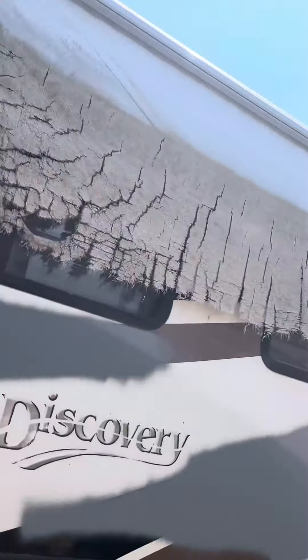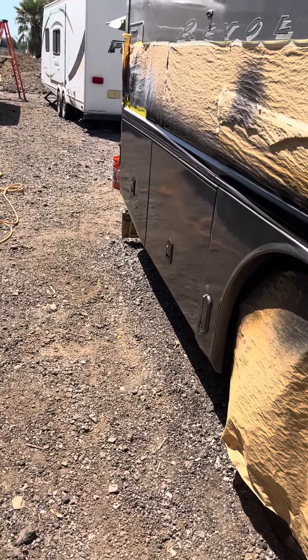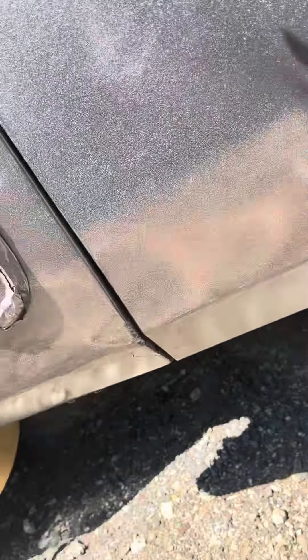There are a couple other things you might notice — right now it's probably about 80 to 90 degrees outside. You might say, how can you paint with these materials not drying on you? Well, you're moving pretty fast, so I'm getting everything really wet to look like a mirror. That's one of the things you've got to do. A lot of painters don't know how to stop, so what I do is I paint it until I see my reflection. Down here there's a very low reflection, but up top you're going to see a high reflection.